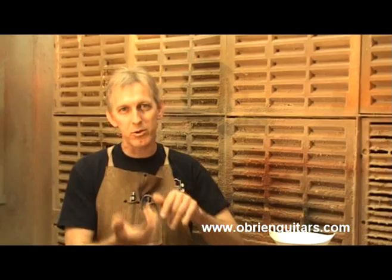After I mix it and put it in the gun, I'm going to once again dial it in on the side of the spray booth. I'm going to regulate the pressure, how much product's flowing out, because it's going to be a lot thinner this time than it was on the previous coats. All right, so here we go.